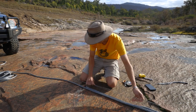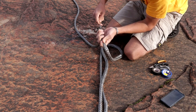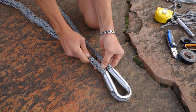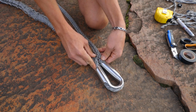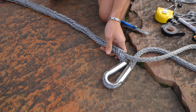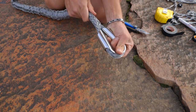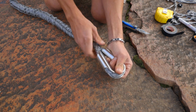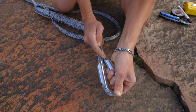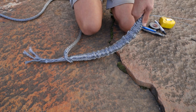Just like last time, we need to grab our fencing wire, put it in about here, and slowly feed it through so the rope goes in about here. Open it up, find the fencing wire, then attach the end of the rope with tape just like we did last time, and feed it in. Pull on the end of the fencing wire to draw the tail through. That looks pretty good — just enough slack so it won't rub. Now just milk this down and the tail will disappear into the dyneema.